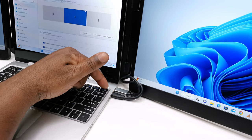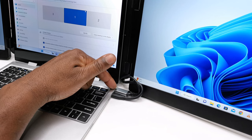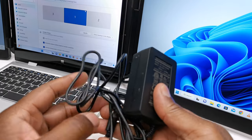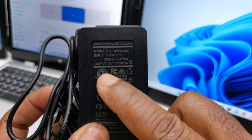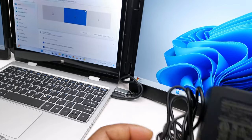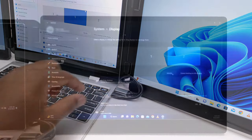When connected to the monitors, the one that's connected to the USB Type-C port can also pass through power from the monitor to the notebook if you power the monitor with the notebook's power charger. You need not to worry about damaging the monitors, because each monitor can pass through 5 volts up to 20 volts 5 amps max to charge the notebook and power the monitors simultaneously.